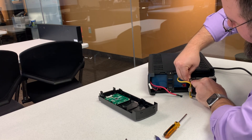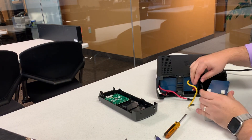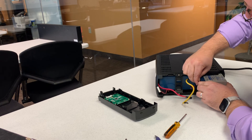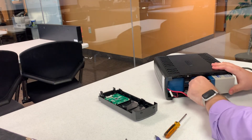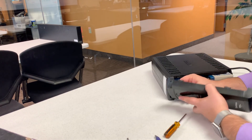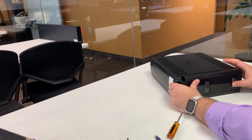We've got our bottom battery labeled — yellow is on this side and black is on that side. Slide this guy in... actually, let's get the new battery first. So this is our black — bend that down just a little bit more, there we go — and then our yellow. Then slide that yellow cable down underneath and that'll push right back in. Before we do the power, go ahead and reconnect the ribbon cable — it'll only go in one way, so not a big deal. Then connect the red.